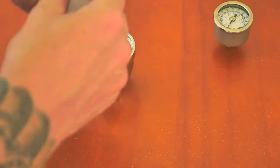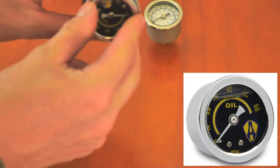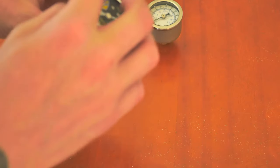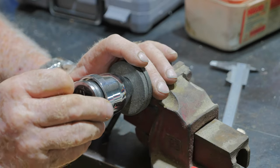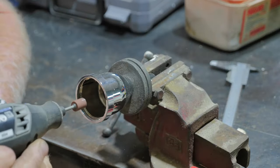Because I had very little confidence in the quality of that gauge, I went ahead and bought an Arlen Ness oil pressure gauge for $70. Now I'm going to try and fit the Arlen Ness oil pressure gauge into this housing from the eBay kit. And what do you know — it is not a direct fit. So I'm going to take to the housing with a little dremel to try and take a couple of mil off, and we'll be good to go.